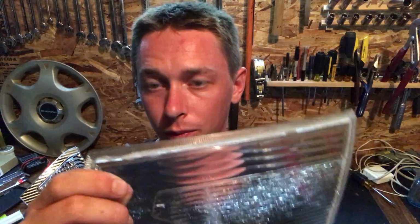What you want to do is sand either vertically or horizontally. That way you can see when you switch your sandpaper. So if you're sanding with 60 this way, you switch to vertical with your next one. 150 is what I did. And that way if there are any scratches or sanding marks going horizontal, you know you need to get those out. When you're going vertical and you're stepping down, you're taking less and less material off as you step down between your sandpaper.